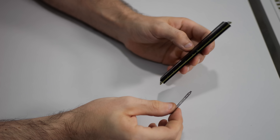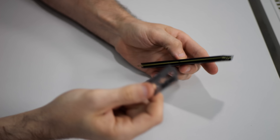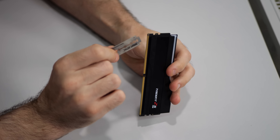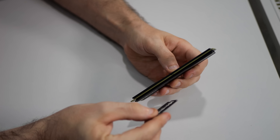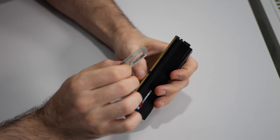You might need more than one razor blade because as you cut the glue, it kind of sticks to the blade and becomes difficult to cut further. Be very careful doing it this way because I've almost sliced my finger off — these things are razor blades. So you're going to have two sides: a foam side and a glue side. If you have double-sided RAM it's going to be glue on both sides, but single-sided you have foam and then a sticker kind of thing.